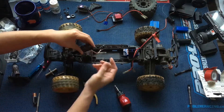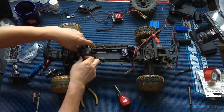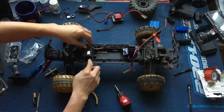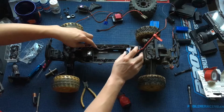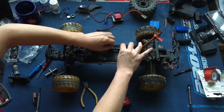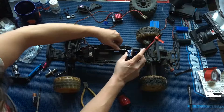So that's how you fit an XL5 ESC into the Spectrum receiver. We've already unscrewed the retainer for the receiver, so we pop this in. One thing about these ECX vehicles is that the wire routing can sometimes be a little odd — the receiver's mounted here and the wire goes through the chassis. We can feed the wire into this channel on the side just to keep it out of the way, then mount the ESC with some double-sided tape.